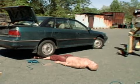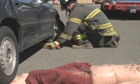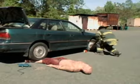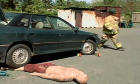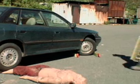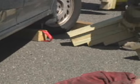The first thing we want to do is stabilize the vehicle on all sides. We want to chock the tires to prevent the vehicle from rolling. And we're going to place step chocks at 4 points on the vehicle to prevent any unsuspected movement.